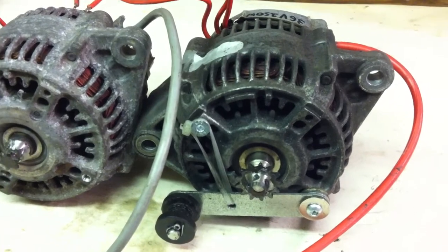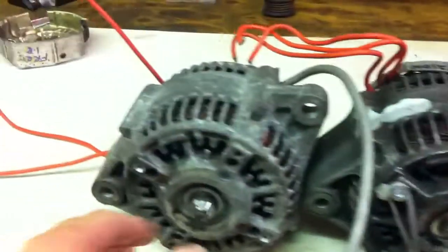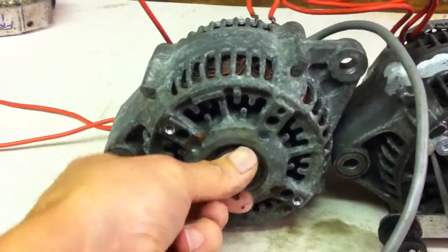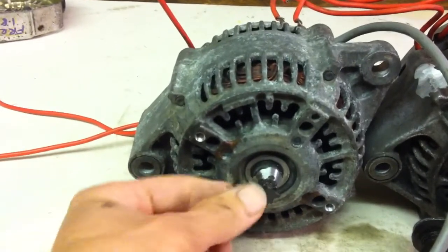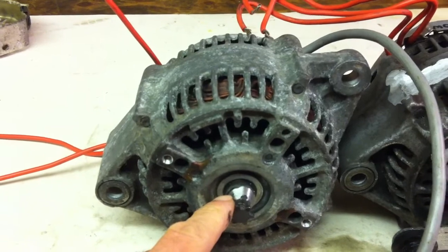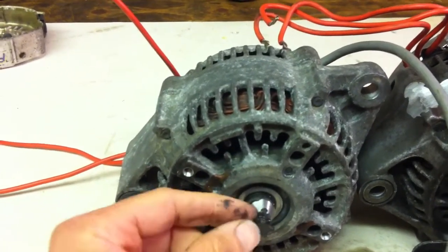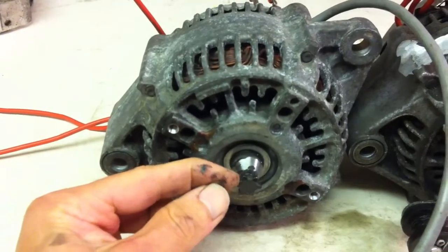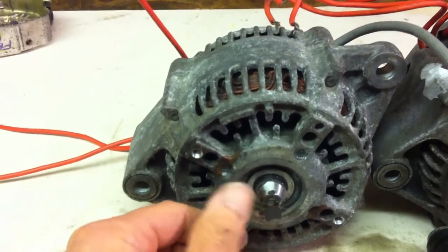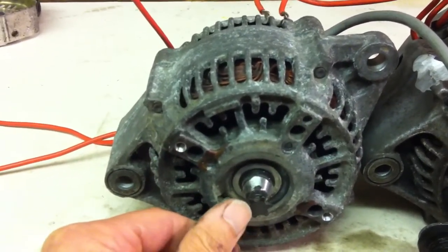The observant will have seen what the difference is here. This is a 13-tooth sprocket, and this is a 6-tooth sprocket. What I've done with this one is centre-drilled and cut off the shaft — it's a pinion gear for a mini moto type thing. It uses the same 6mm chain.